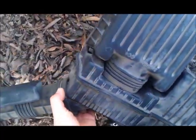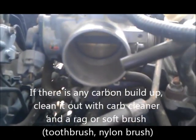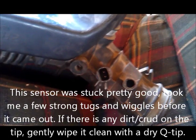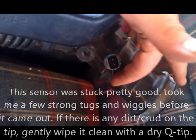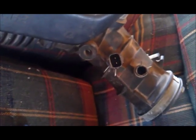Now I'm completely disconnected. I'm going to take a look in that throttle body — it's pretty clean. I might get in there with a soft bristled brush and wipe out any little residue. Once you take off the stock air tube, it's easier to take this sensor out. There's a little clamp here — squeeze it with pliers and pull that thing out. You'll need it for putting on the new intake.